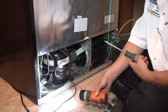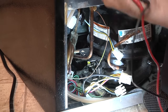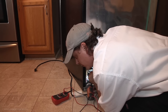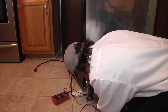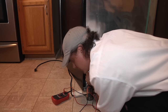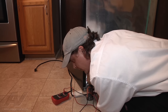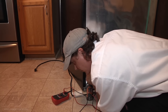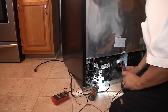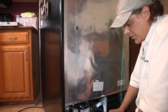The starting components have a little metal clip holding them on. To take that metal clip off, it hooks on the bottom, wraps around, and then hooks on the top. The bottom two pins are showing me about ten ohms, still fluctuating. The top pin and the pin closest to me is fluctuating quite a bit, settling right around five and five and a half. So we're pretty close as far as the windings go. I can't definitively say if it's a bad compressor at this point because the windings are showing fairly close to what they should be registering.